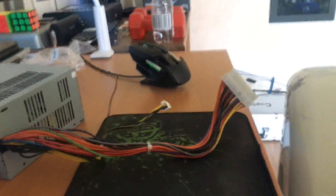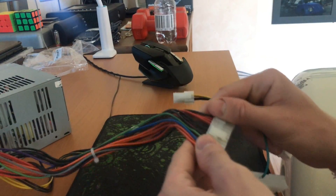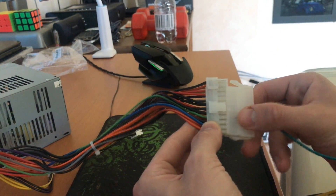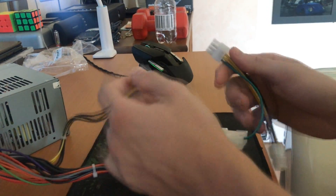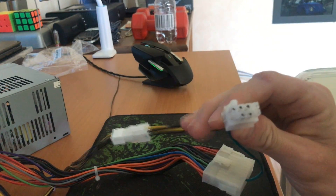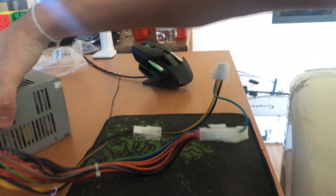You take the 24-pin connector — look where the top tab is, there's also a lip on the side — and put it on the left side so you can bend it into place. The other connector goes into the secondary port. If your power supply has more connectors, that's fine. The 8-pin then plugs into the eGPU. Again, I do not recommend this setup.